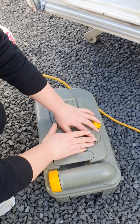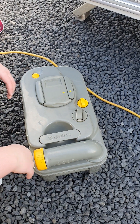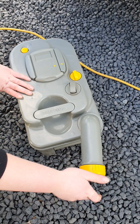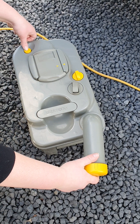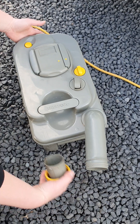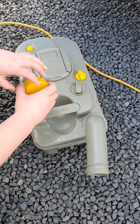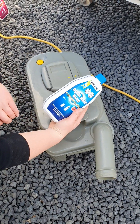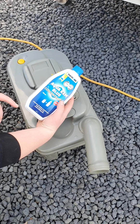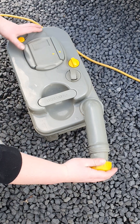These three items are operated inside the van, so you don't need to worry about those. When you go to empty your toilet cassette, spin the spout out. If you have any issues getting this cap off, there is a small air release valve at the bottom that you can push, and then the cap should come off no problem. On your cap you have measurements designed to measure the blue toilet chemical — this helps with smell and is designed to help break everything in your cassette down so it's easy to empty. Measure that in, put that in.